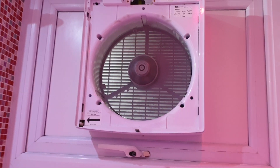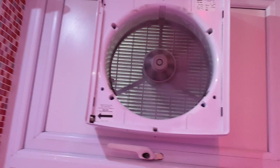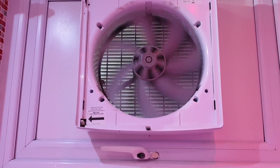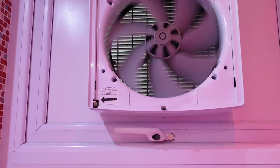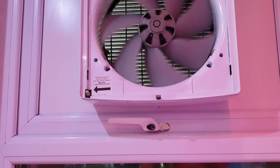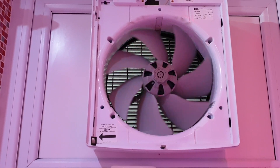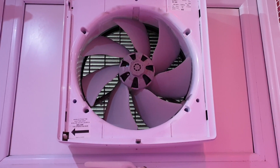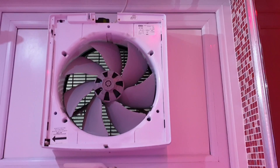If you've got the symptom where the fan is running slow, before you think about replacing the motor, think about changing the motor run capacitor. Mine was rated at 2 microfarad, 400 to 450 volts AC. Motor capacitors are typically rated from 400 volts onwards. Problem solved — that's all, thank you.